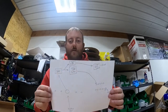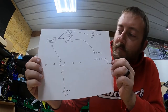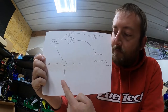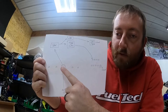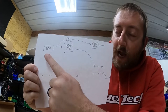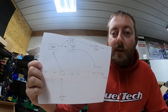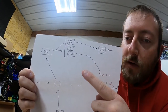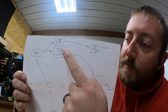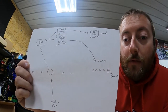On this drawing: I have 12 volts coming in from my battery, and then I have another wire on my battery going to my tether switch. Out of my tether I'm branching off into two wires — one is going to the incoming side of my start button, and the other is going to the incoming side of the on/off toggle switch. Out of the start button goes to the start relay, and you also have to ground the relay in order for it to work.